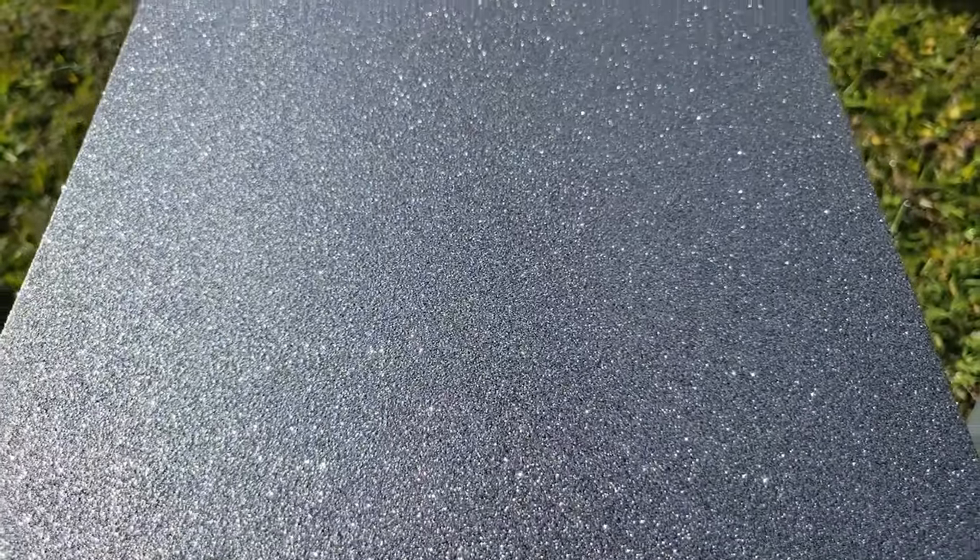What a work of art — that is beautiful. Wait till we show you the finished product once it's cleared. You saw all the steps we took: from sanding to priming, mixing our Comet Silver and Abyss Black, applying everything, and then mixing our inner coat and shooting our metal flake. We showed you two different processes — 50% coverage of metal flake over Comet Silver, and 100% coverage over Abyss Black with our 2.5 Tropical Glitz gun. Everything on this video you can see on our website and purchase at tropicalglitz.net.